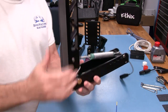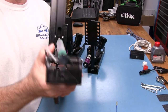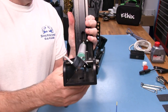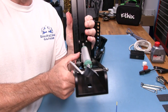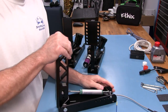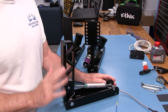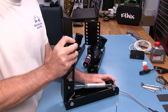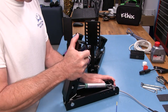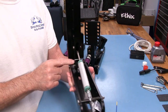The throttle is a spring-actuated unit. You can see the spring here, and they do have another spring available that's supposed to be 40% less stiff than the stock unit. On the bench it has a good stiffness, but you really have to have it underfoot with the weight of your leg to tell if it's right for you. There is an option to switch this out, and the procedure is not too difficult.